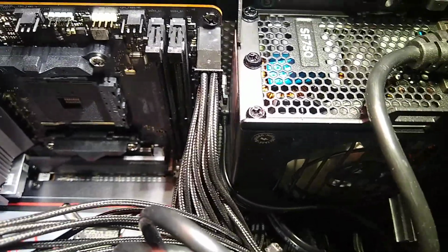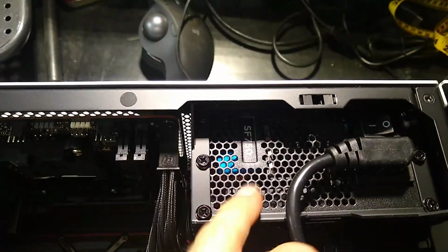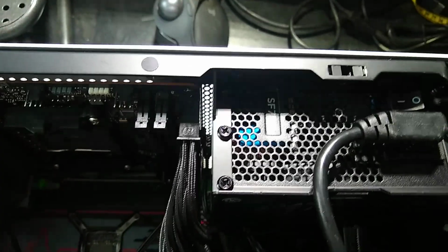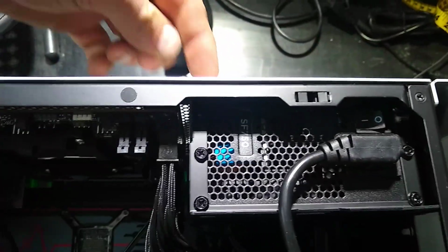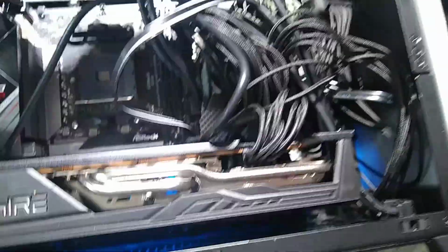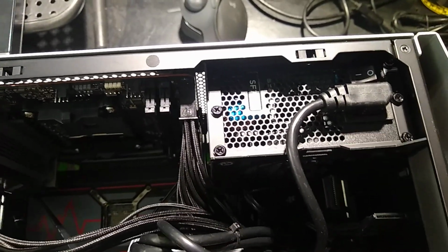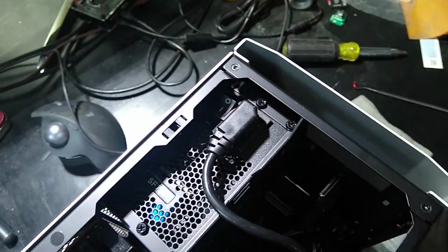If you want to change out that serial ATA connector, which is a right angle connector, what you have to do is you have to move this power supply. There's zero clearance between it and the plug that's plugged into the edge connector on the motherboard there. Thankfully it's kind of easy on the NCase M1. There's a screw here, screw there, and there. So 3 screws, and you can swivel that out of the way and change that connector, which is fine. Unless you're changing it a whole bunch, I don't see why you would need that to be any different. This arrangement, I think, is the one that is used by default on the NCase M1 version 5. And for the 6.1, they've also added a front position where this goes rotated that way.